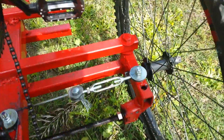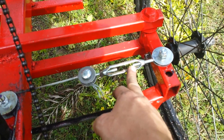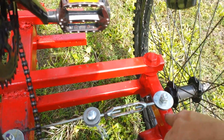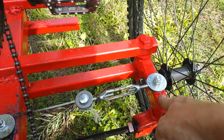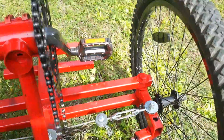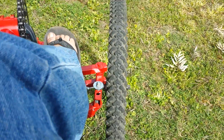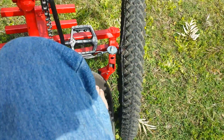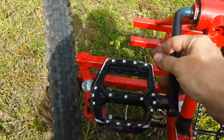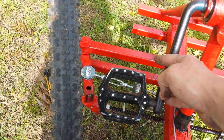The main thing I did with the bike is, when we constructed the front end, we had these tie rods down here, and they were so far back from the pivot point that when you turned it had the turning radius of a large truck. So we scooted them further in, and now I just have enough room that if I stick my leg here with the pedals back, my foot clears the wheel on each side. You can see how close it gets — about an inch or two. I can actually tighten this up and make it turn a little bit sharper if I need to.